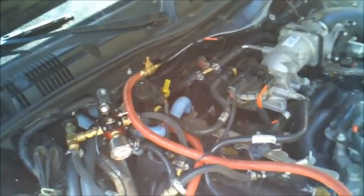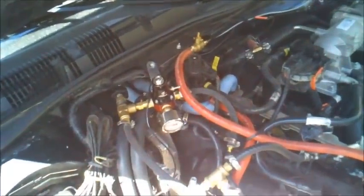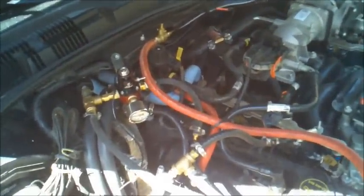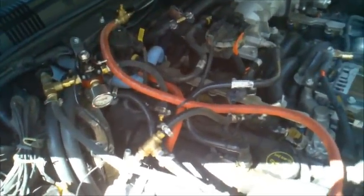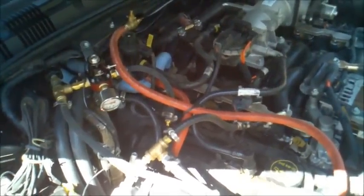I've altered the plumbing and everything several times trying to get the best run on just the hydroxy, and we've had some pretty good success. We've got our new pressure regulator in there, and basically what that's for is — the computer controls the fuel pressure on the rail, and we wanted to take that control away. When it escalates higher than what we can manage out of our blue box, this is actually going to return the excess fuel to the gas tank.